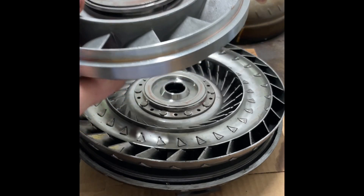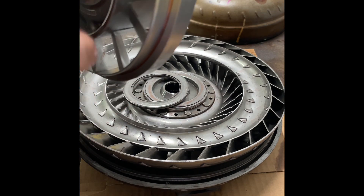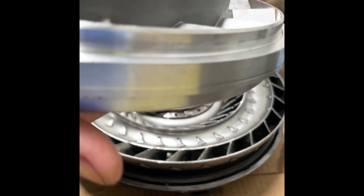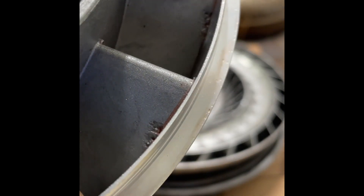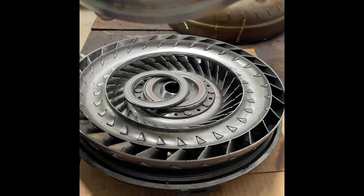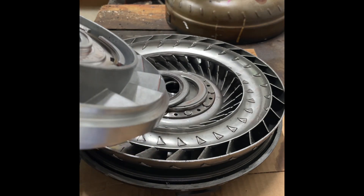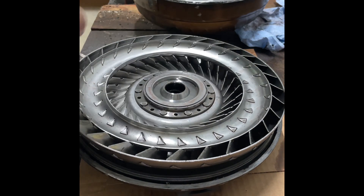The stator - I'm not sure it's perfect, honestly. I think some of the aluminum I found in my original filter when I cut it open was from these fins - they've kind of eroded. I'm not sure if that's a common failure or if I'm just overreacting, but some of these fins are eroded with pieces of aluminum missing. It could just be poor casting from the factory. There was some cast aluminum in my original filter, so I assume that's probably where it came from.